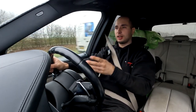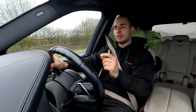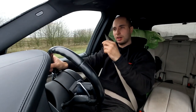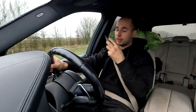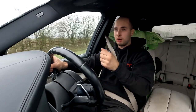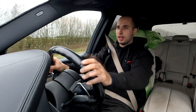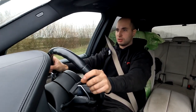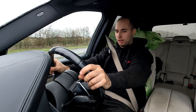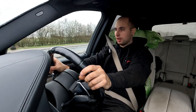I've done multiple test drives previously. I did notice there was a very tiny oil leak around the dipstick, but it turned out there was slight damage on the dipstick O-ring. Thank God it was easy to take off and replace. Nothing on the turbo side, everything seemed to be dry. And nothing suspicious whatsoever. So yeah, I'm really, really satisfied with it, and it drives completely fine.